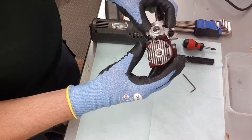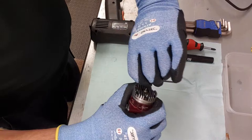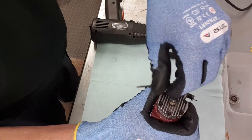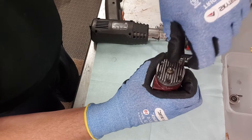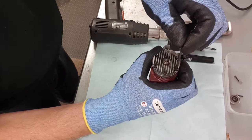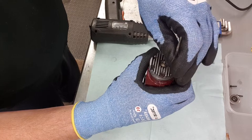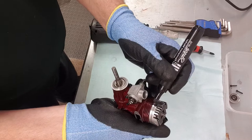Taking a look at the engine, the first thing we've got to do is remove the cylinder head, which is done by removing the allen bolts at the top. I've already got the allen key ready to go. The prop driver has just slipped off — drop that in our tub so we don't lose anything. I've already cracked these loose, and I've also match-marked the cylinder head with the marker pen so when we come to assemble it again it goes back in the same place.